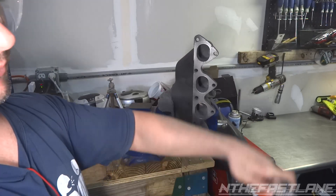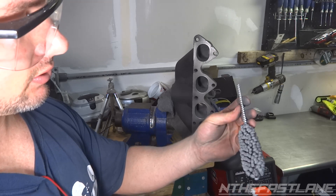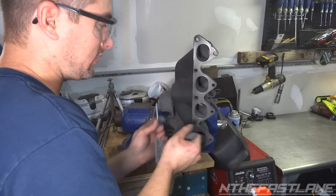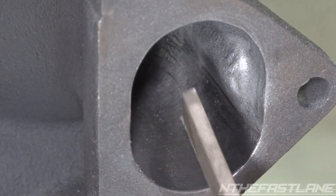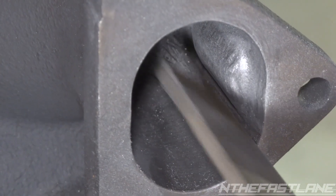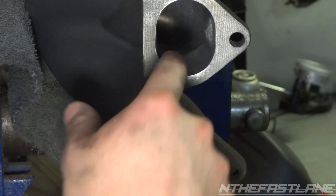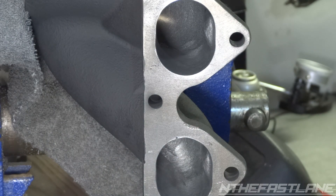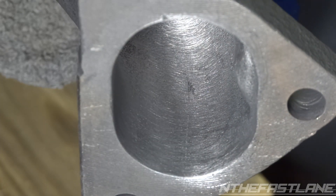Here's a little problem — if you start wiggling too much you will snap the wire. Pretty surprised I actually snapped it; I wasn't really pushing too hard, but that'll happen so be careful with the up-and-down and sideways bends. Now for some of the pits, I'll take a file, stick it in there — on the side of the file it has more grooves where it can carve out — and just get the chunks out of there, then I'll hit it back with the hone. You can see how it's starting to really polish and smooth it out. There are no burrs and the air is gonna flow really smoothly in there. Keep in mind this is cast iron and it's shining like cast aluminum — you can really see the difference.